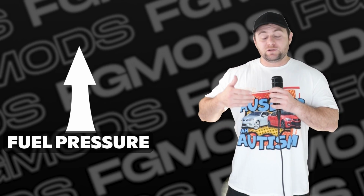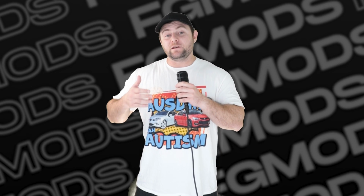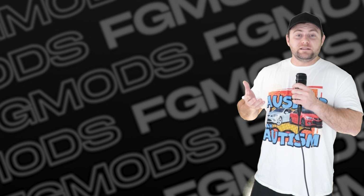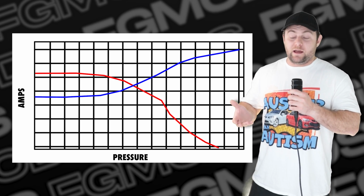And as the fuel pump has to work harder to pump the fuel, the efficiency with which it does so goes down. This is because the fuel pump is experiencing frictional forces from the high fuel pressure. So even as the fuel pump works harder and harder and more power is being drawn, less and less fuel is being moved. And what you end up seeing is this diminishing return, where as you push the fuel pump harder, you're getting less and less fuel for the amount that you're pushing it and the amount of power that you're drawing.